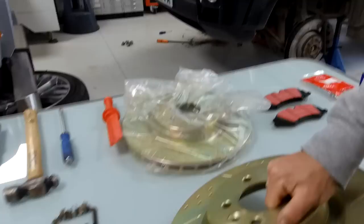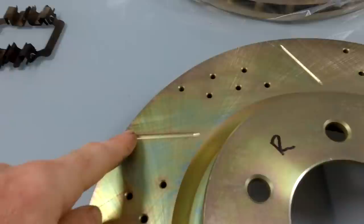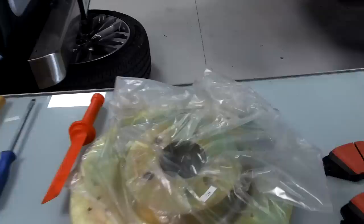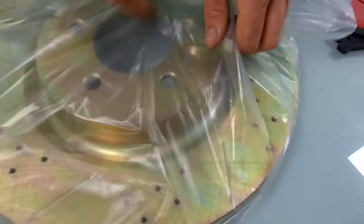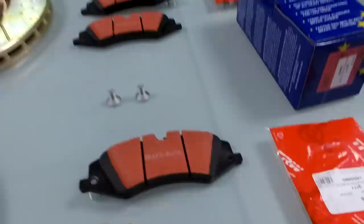So what do you need for this upgrade? We've got drilled and grooved brake discs. As soon as you open the bag, get your pen out and put an R on there before you forget which goes on which side. On the right-hand disc the grooves go anti-clockwise as they work outward, and on the left-hand disc the grooves go clockwise - that's the difference between the two.